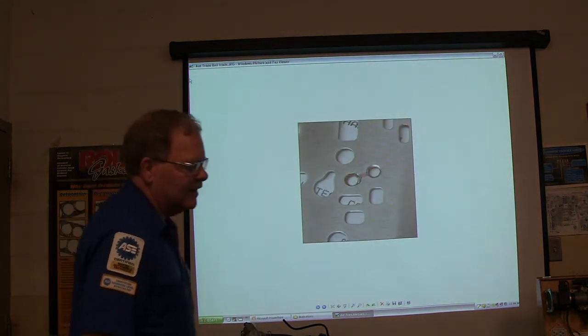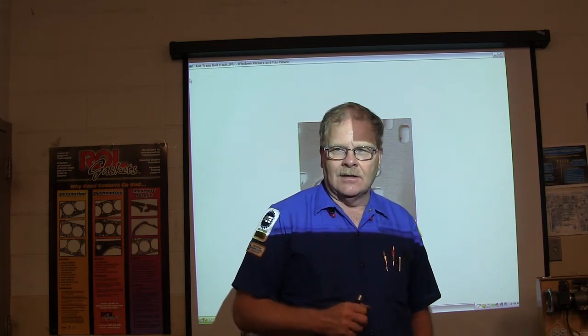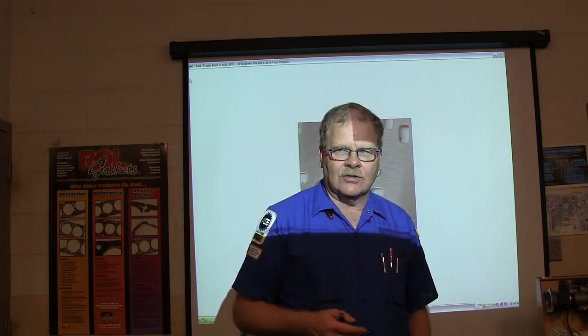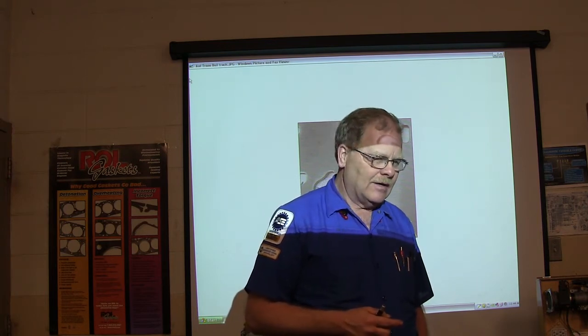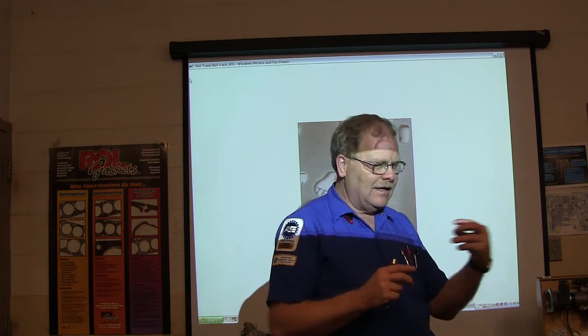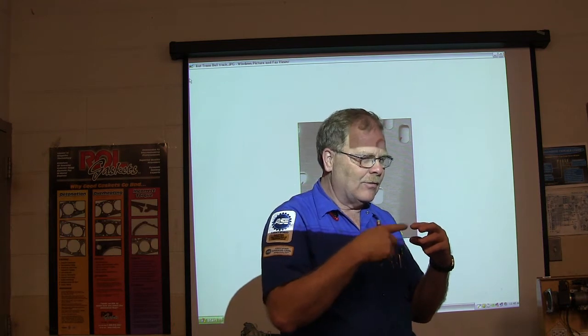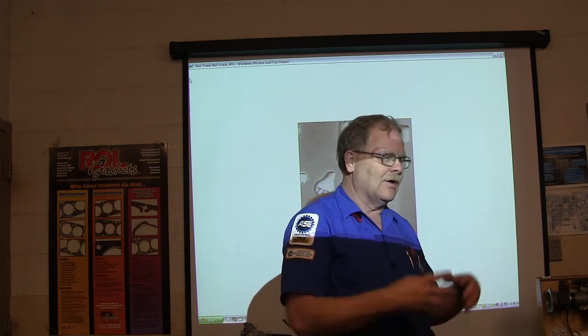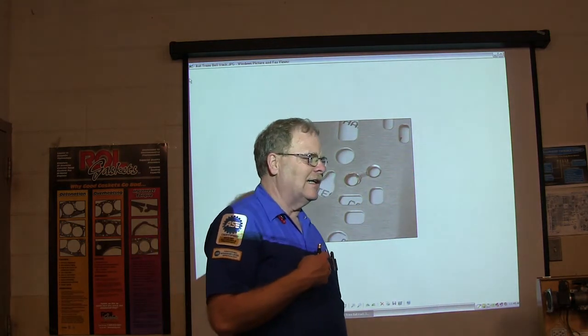Here's an interesting story. When I went out in the first semester I was here, we rebuilt the transmission in a 1991 Nissan hard body. The owner said we went over a railroad track and it just quit pulling. What we found out was the torque converter was wiped out — the turbine shaft had wiped the teeth out inside the torque converter, and there was metal all throughout the transmission. So we tore it down and put in clutches, seals, and all that. But we made a critical mistake.